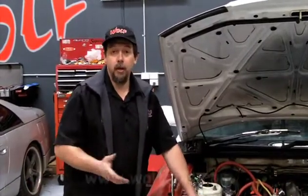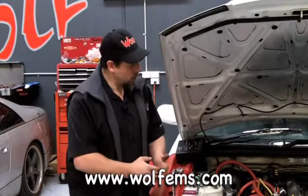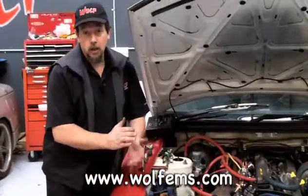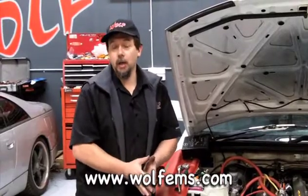So the power draw here could pull the power source down to 10 volts. If you're trying to drive six injectors, six coils, and a starter motor off 10 volts, it's not really going to make for a nice starting car.